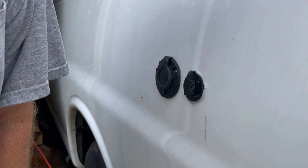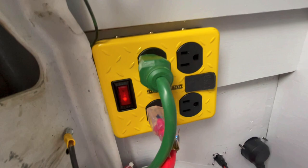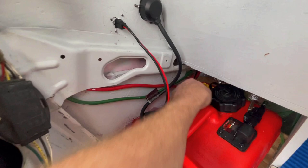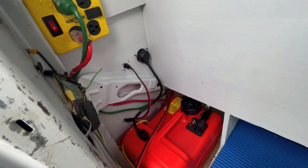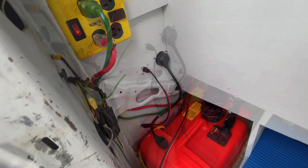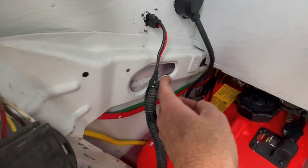Now what we have to do is take the yellow cord from the Yellow Jacket and plug it into this. Down here is a 10-gauge cable, which is the same size as this receptacle, and that will run over to the charger control — the solar controller — on the other side. For the solar, it's got a wire coming from the solar controller. I went ahead and put one of these ends on, and because I'm going to run this in behind here and out right there, I went ahead and put some wire loom on it to protect it. Then we just plug those in.